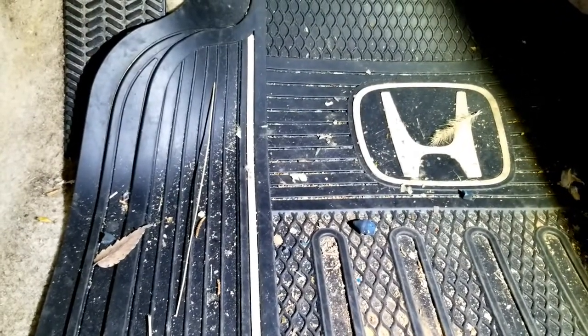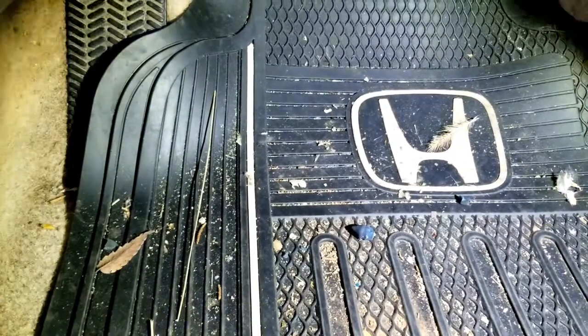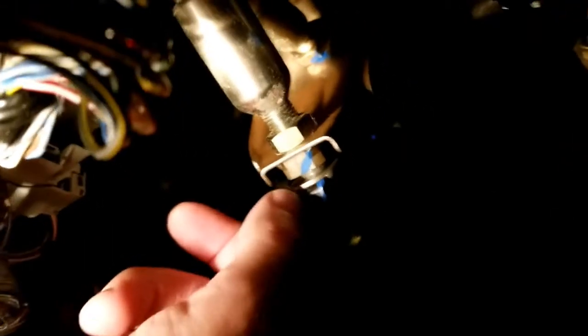I'm going to get the car backed up out of the garage so I have a little more room to work. You have one safety switch here for your clutch. When you push the clutch down you see it lets that open up. I already have a nickel glued to that one because the stopper on it broke once upon a time — what that causes is your cruise control won't work. When your car actually will not crank up, it's this upper one here.